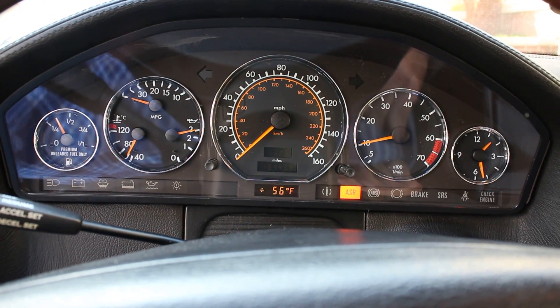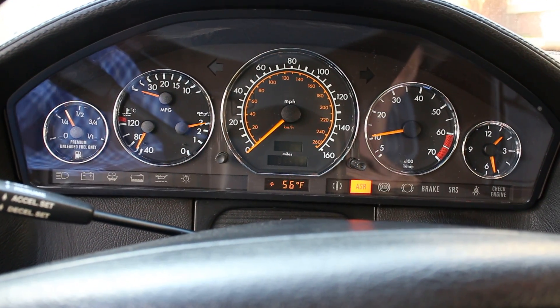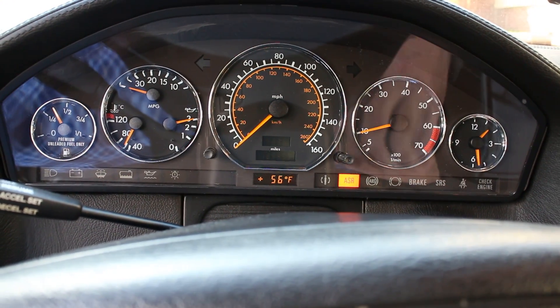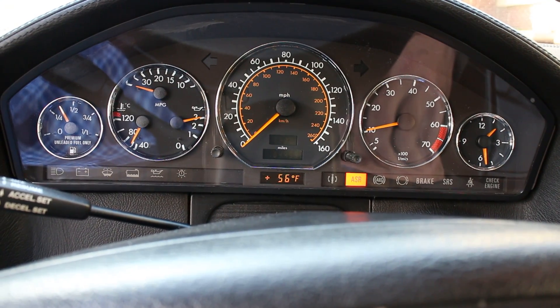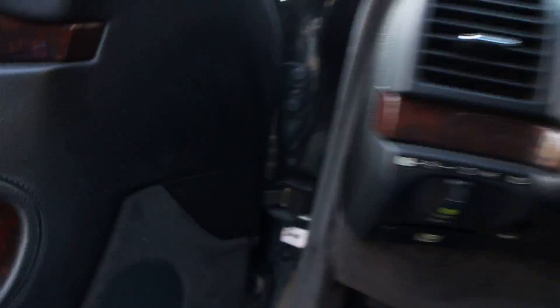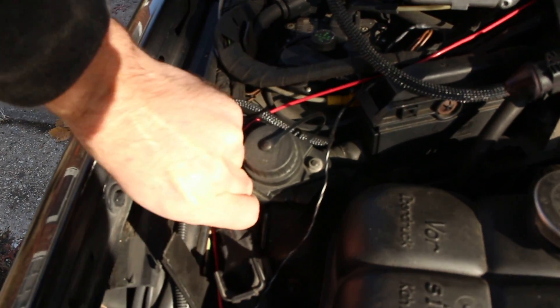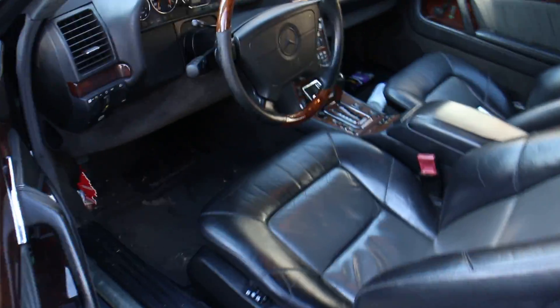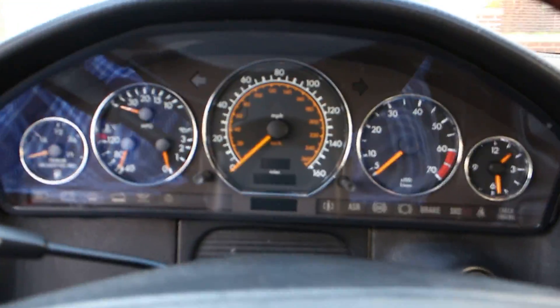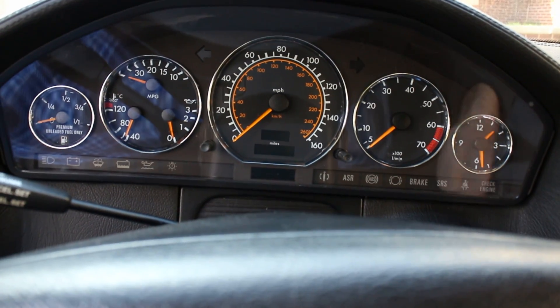We're only accelerating on six cylinders — only six cylinders get enough air, the other six are just idling. The whole engine runs in a very bad mode: six cylinders running, six cylinders idling. We have the ASR light lit up, but at least we have some acceleration. There's also a very strong odor from the exhaust. Now the last scenario is when we connect both throttle bodies to the vehicle and start the car normally — no more limp mode.